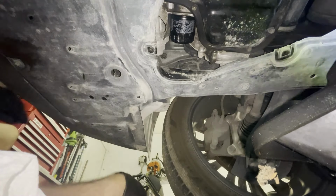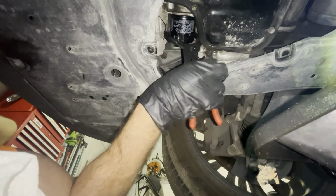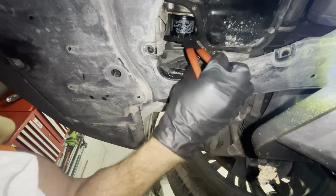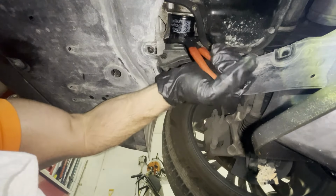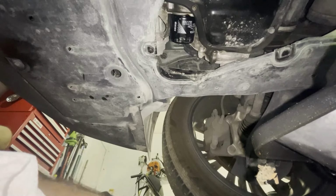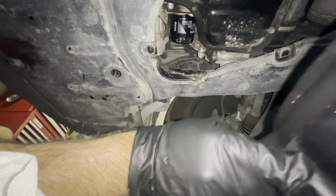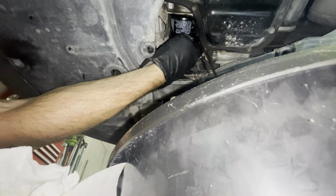The next thing we're gonna do is take off the oil filter, which can be kind of snug. So you may wanna get one of these adjustable wrench tools, which I'll put in the description below, and kind of grip it. And you wanna pull it towards yourself to loosen it up so you can then finish it off with your hand. There we go. So this may drip some oil too. So you may wanna move your pan slightly underneath that as you open it up.